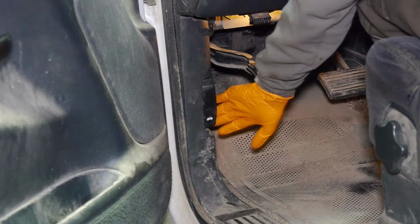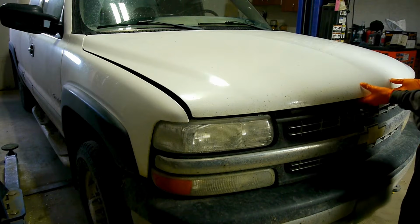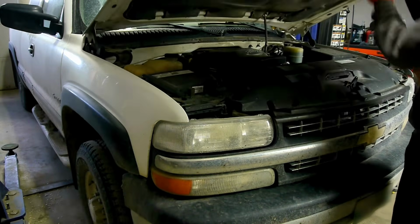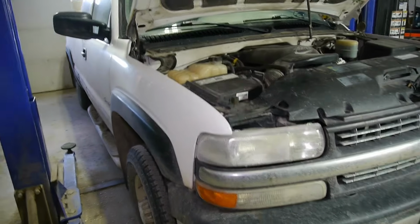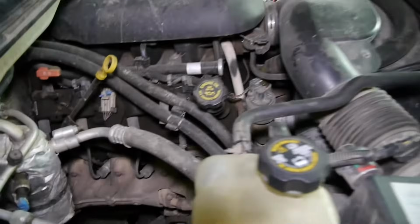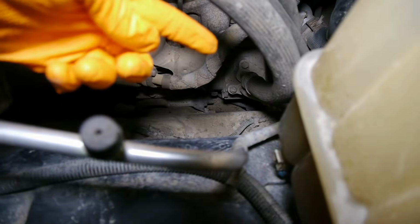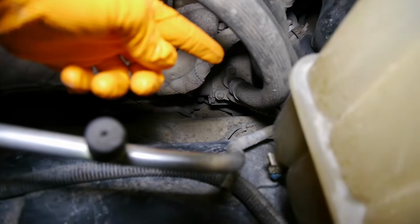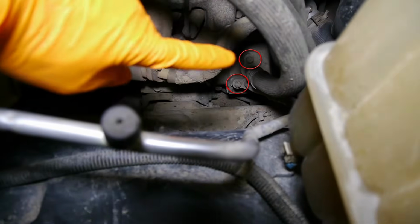Follow me by just popping and then opening the hood, since everything can be done from the top without going underneath the truck. It's actually pretty simple to do the clutch. But General Motors had two different styles of AC compressors. This one has two bolts holding the AC line to the compressor. Some only have one, and that one is a complicated one to change the clutch only. This truck has two though, so let's get started.